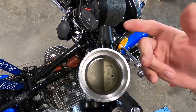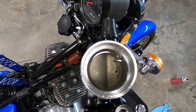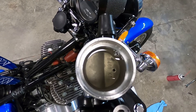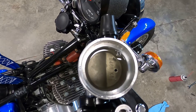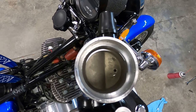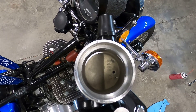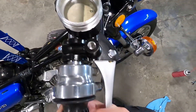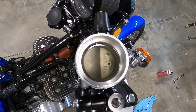Air is lighter, so it's going to find its way up the brake line or get trapped somewhere. With no handle at all, as you can see, when I push, the air coming back up the line is actually coming back out through that hole. Do this slowly — it's not like a car where you just pump it 500 times and crack the line open. We're going to do this slow until we've got no bubbles, and then one last time we'll bleed the brake lines. I'm starting to get a nice good grip and a fairly firm handle, but it's still not where it should be — still getting another bubble out.